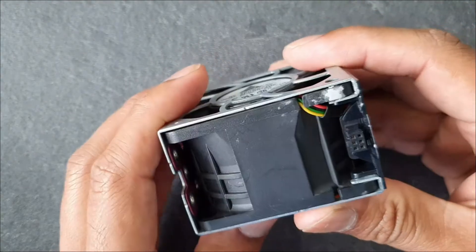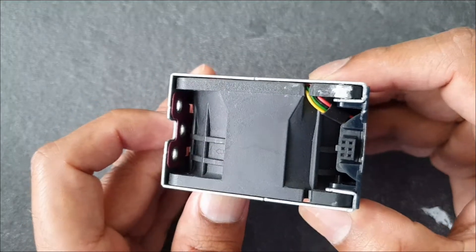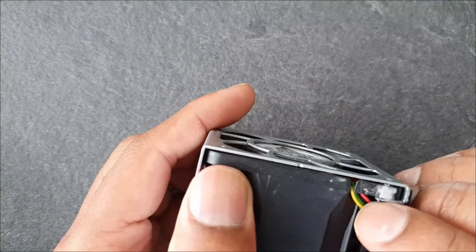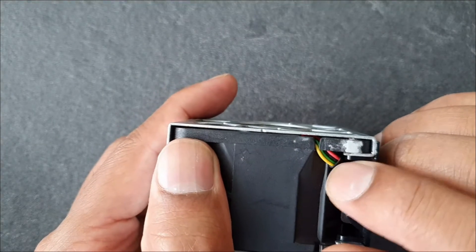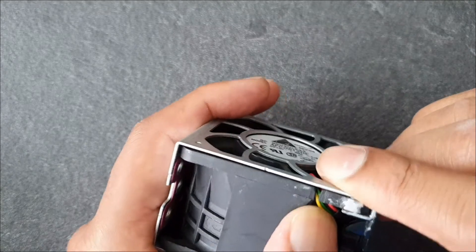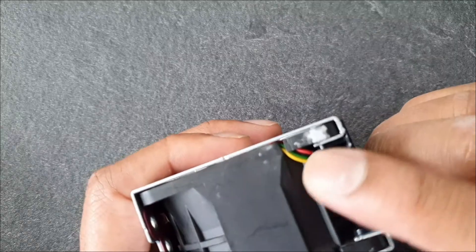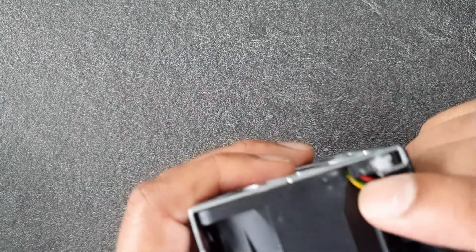There are six pins to connect that fan, but normally in a desktop fan there are four cables. You can see the cables behind the fan — behind the pin there are actually four, the same as desktop. It's red, black, green, and yellow. Red and black are actually for the power supply — 12 volt.